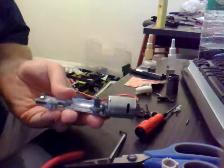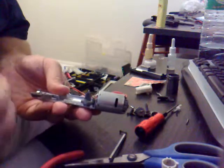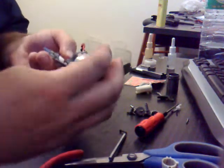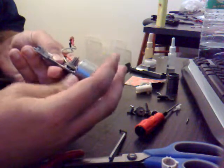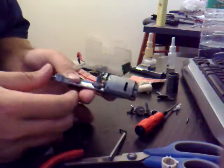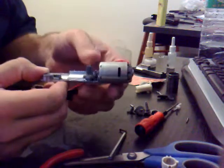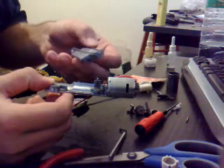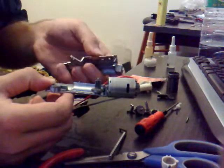So if I go over what I'm doing: we start off here after having cleaned all the gears, got rid of all the dirt and crap off there. I've just loosened the motor slightly here so it just sort of rises up so we can get this in and out. I've just taken everything out of there — it's easier to get the shim in right that way. Then when we've got nothing in there apart from just the last gear, we put the casing on.